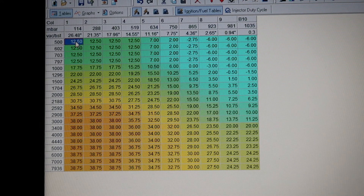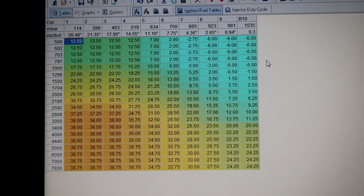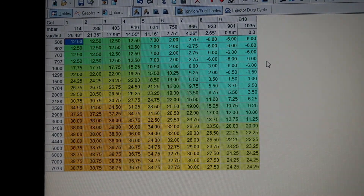Get your mechanical timing synced up to the base map — to 12 degrees on your Y7 or Y8 — and you should be good to go to tune from there. From here I'll pull timing throughout the boost maps, but I'm not quite ready for that yet. If you like the video, please like and subscribe and I'll see you on the next one — thanks for watching.